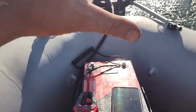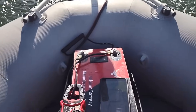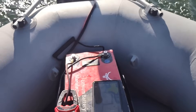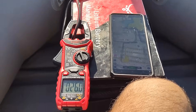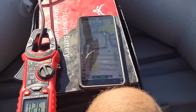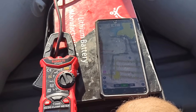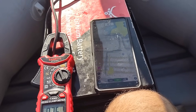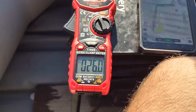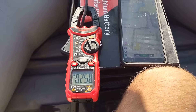Go with these APC props — they are one third of the price and totally worth it. You could buy three of these props, put a couple in your tackle box, and you've got yourself almost an electric outboard. This cruises up to four and a half miles per hour; with a little wind it drops to about 4.1 to 4.2. The power savings alone: going from 3.7 to 4.3 miles per hour while saving nine amps — and with a 150 amp-hour battery, this setup should run about five and a half to six hours at full speed.